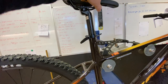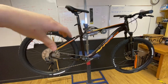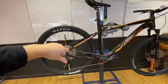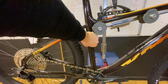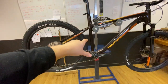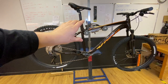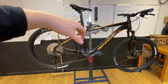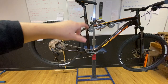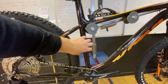Being the XL, it comes with quite a large seat post — around 400mm plus. Smaller frames come with smaller seat posts. If you're mounting a child's seat on the back, there's plenty of space here with good grabbing room and plenty of clearance between the tyre and the seat tube. You don't really run into clearance issues until you get to the small frame Blast or Fire Mountain on 27.5-inch Kona hardtails, where the gap becomes too tight to get a clamp in.